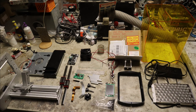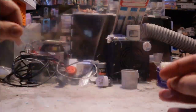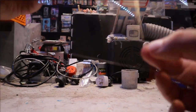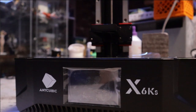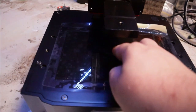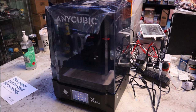A thick screen protector and instructions were included. Easy enough to install — clean up, remove the scratch cover, peel back the adhesion strip, and apply and flatten with the scraper. No need to fear if you have the slightest creases or bubbles. I've used Gladwrap in the past to protect my former printers with no impact on print quality. I like that it can be reused by peeling back and scraping resin off without tearing.